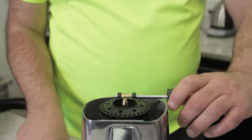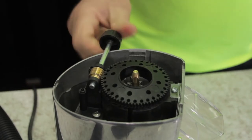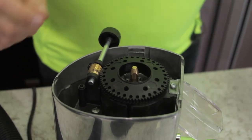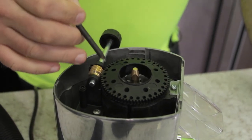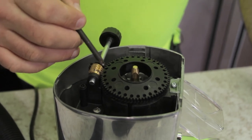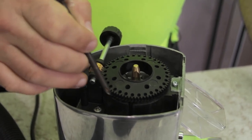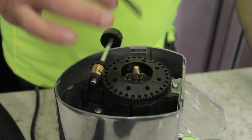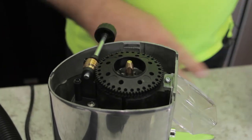Just a little tighten, and then just to test — everything works fine. Sometimes if you have coffee grinds stuck in there, you can also damage the worm gear or the setting blocks on the carrier. So that's why it's really, really important to remove every single piece of coffee grind.